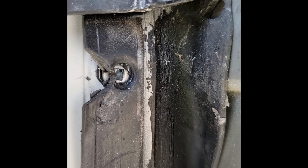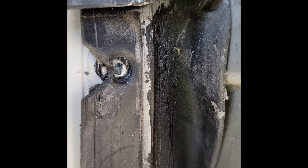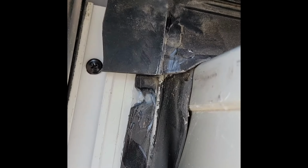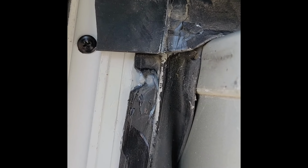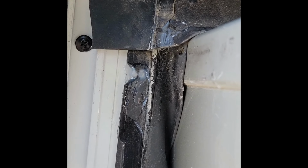There's a screw back in place with the JB Weld holding it in. I used the quick set stuff, so it'll cure enough here in a few minutes. There, I finished it off with a little bit of silicone seal just to be sure that it doesn't pop out of there. And now we can put the screws back in and put it all back together.